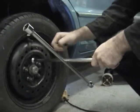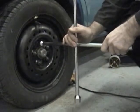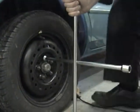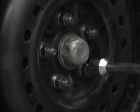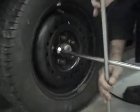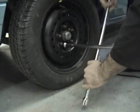I'm going to loosen all the wheel nuts in a diagonal fashion so that we don't warp the wheel or the braking system. When I say loosen, I simply move the handle from 12 o'clock to 9 o'clock position — that's it. Since I said diagonal, I skip the adjacent nut and move to one diagonally across in a star-like pattern. You don't have to remove the wheel nuts completely — just enough so that when the tire is up in the air you can still remove them without excessive effort.